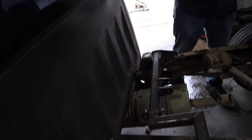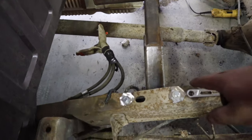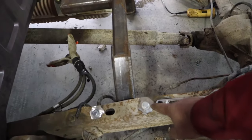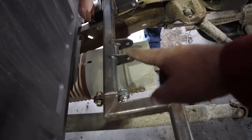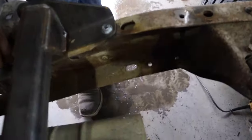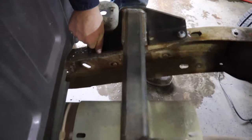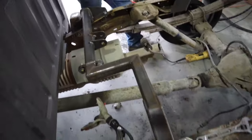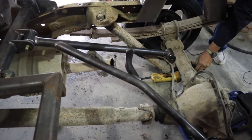On your Infamous kit for the raised tank crossmember, this side of the crossmember will line up with all three of the factory holes. Then on this side, you have the factory hole in the back that it lines up to — you've got to drill that hole. And just like that, it's installed: crossmember in, wishbone in.